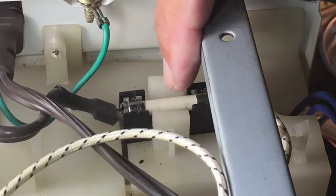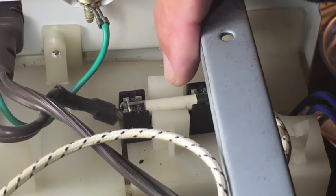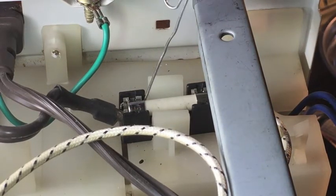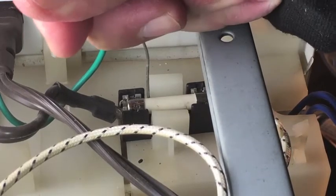I see the capacitor right away — it's down here where those red wires lead, and my fuse is right here on top. Here's a better view of the capacitor just to give you an idea of what it looks like. So here's my fuse, and it is a ceramic fuse. To get it out, I'm going to pull up on it using a paper clip that I modified — I bent a hook down at the end using needle-nose pliers. Put that underneath the fuse and pull straight up, and it should pop out.